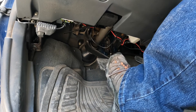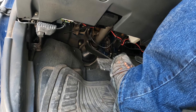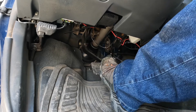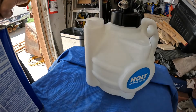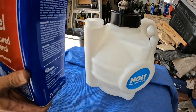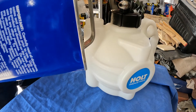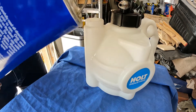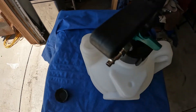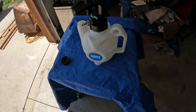I expect the pedal to go all the way to the floor initially, but let's start up here. The instructions just say clean it with a compatible solvent, so you obviously wipe the outside down, but for the inside — whatever compatible solvent means — we're just going to use some denatured alcohol, just swish it around and pour it out. I'll leave it open for a little bit for the denatured alcohol to evaporate.